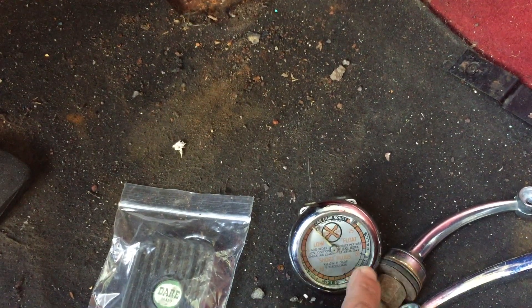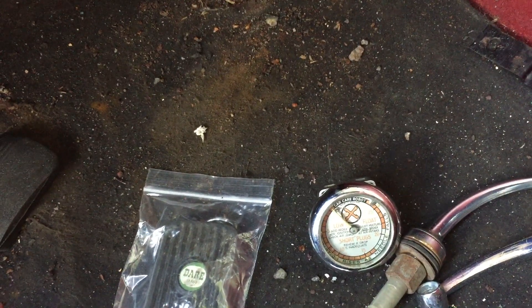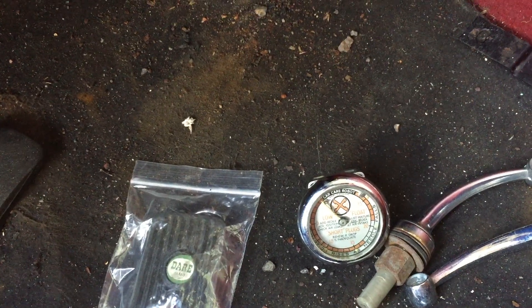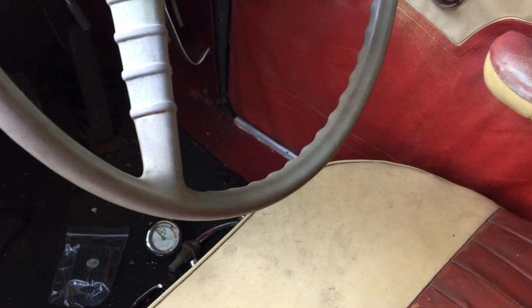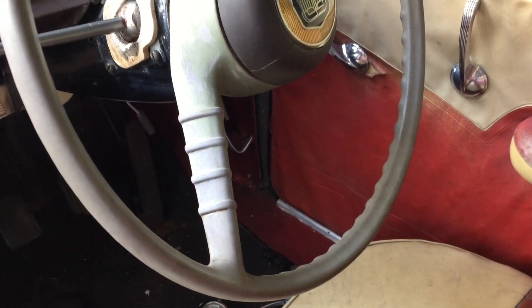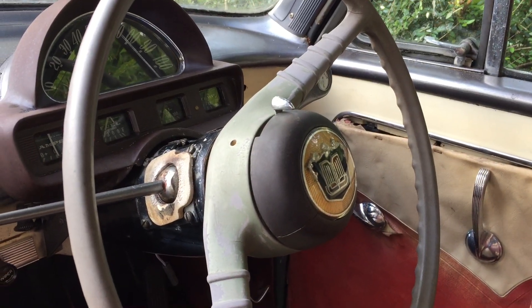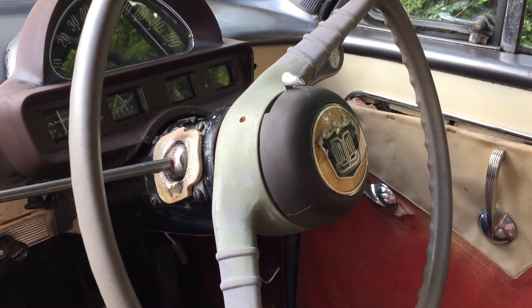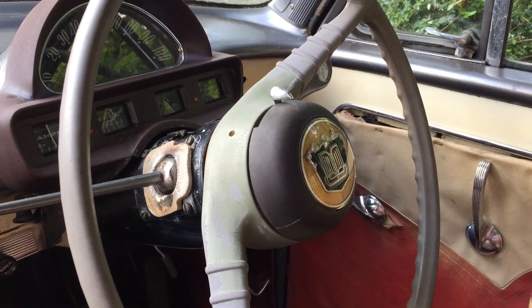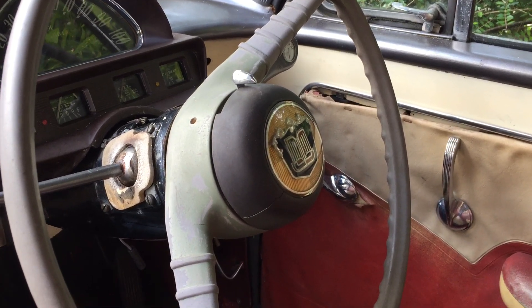It was just fluttering in this white section here, which is indicative of valves. I've not had the rocker cover off yet, so it does want a good thorough service and tuning. But the car started up the other day — first time, first turn of the key — and that was after months of inactivity. The last time I started it was when I videoed it. So that's brilliant.